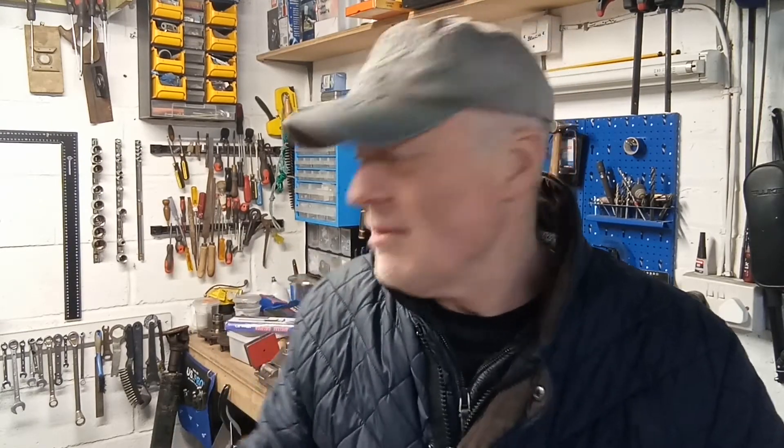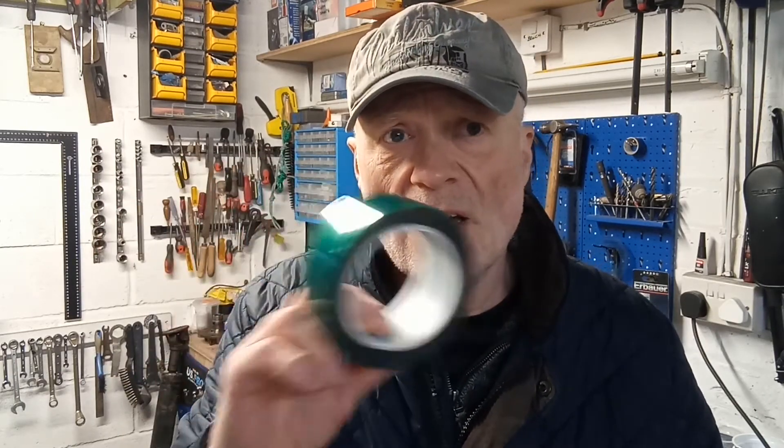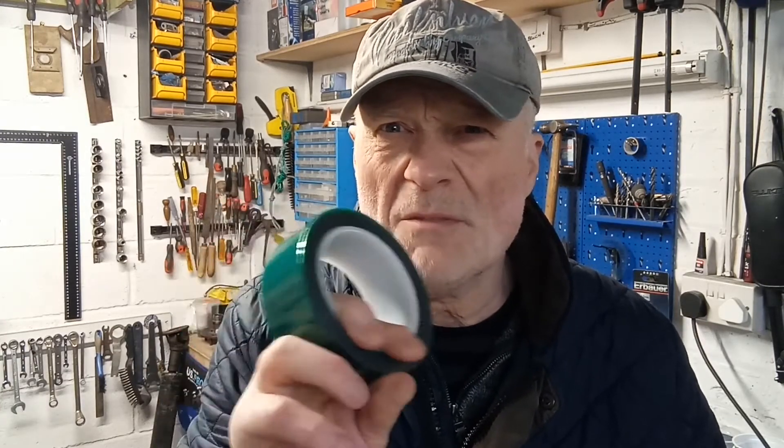I'm really pleased with the powder coating that I've done. This polymer tape is absolutely brilliant - I can't sing its praises enough. It is absolutely brilliant. As soon as your surfaces are clean and free of grease, this will stick really, really well. When you put it on, use the edge of a piece of plastic like an old credit card and really smooth it down, or smooth it down with your fingernail, and it will stick really, really well.